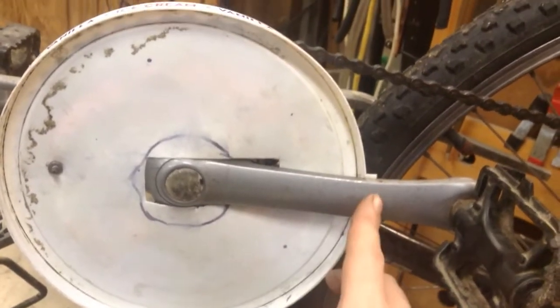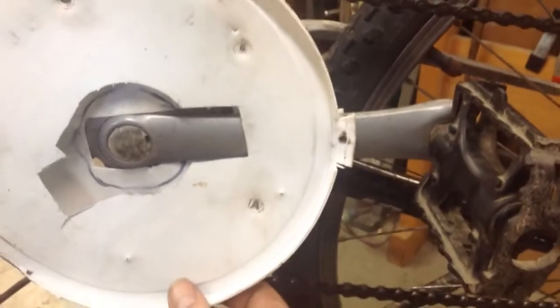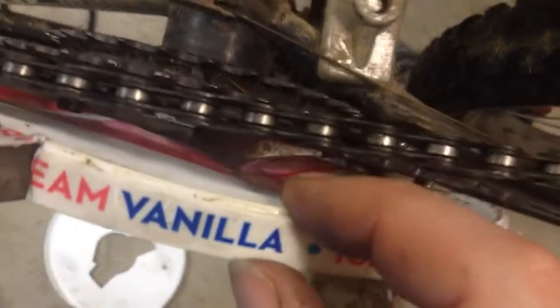I drilled and tapped a 10-32 because I didn't have an 8-32, but you can use a 6-32 if you want even smaller — that's just all I had. Then you hold it up to your sprocket and crank arm, mark it with your Sharpie, cut this tab off the edge, and poke a hole in it for your screw hole. Now there may be a factory screw hole — it's right here behind the crank arm — that you could use on this bike.